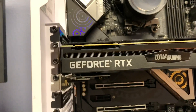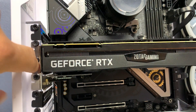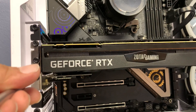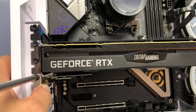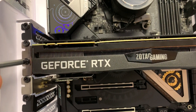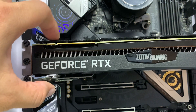It's not really a big issue — it's all a matter of alignment. These cards once they're assembled are bolted on by these screws. One thing you can try to resolve that problem is to loosen up the Wi-Fi card, give it a little slack, let it drop down a bit, get a better angle. For the graphics card, loosen up the two screws that hold it in place — you can see it's being held down by its own weight.